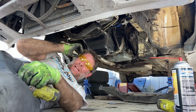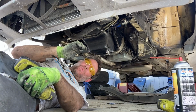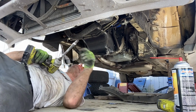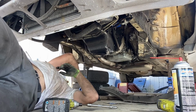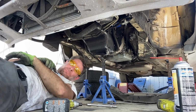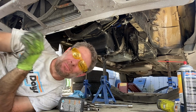What I'm doing, which is surprisingly well prepared for me, is at the four corners of the sump I'm leaving four bolts loosely in so that it doesn't just drop down on one end and cover me in oil. Ask me now how I know that happens. Oh, Mr. Starter's in the way. Bit of added security. Definitely need to start labeling some stuff in some bags.